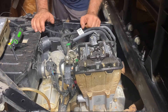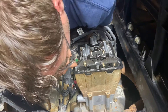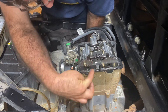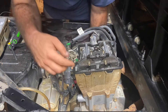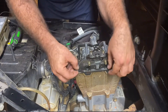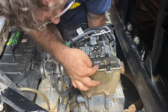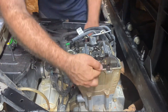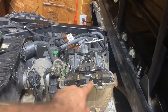There's the wonderful Pro Star dual overhead cam setup. Next thing you're going to want to do is set your engine to top dead center. This is your intake valve and this is your exhaust valve — they're both marked with I's and E's. I have the clutch cover off so I can turn the engine over by hand by rotating the clutch. Pull the valve cover gasket back. You're going to want the I's on this cam so the little lines are parallel to the top of the jug, and you're going to want to make sure the E's are parallel over here — your I's and E's parallel to the cylinder head.